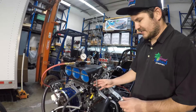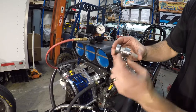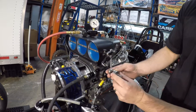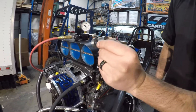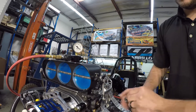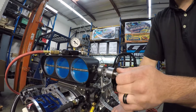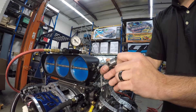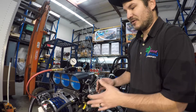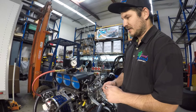To give you an idea of what you're doing when you set the leak down and how that affects things: the metering piston is sitting here and you can see there's a little notch in there for fuel to get by. There's also a notch on the Enderle spool here, which is usually up in about the 12 o'clock position. When we're turning the linkage, we're adjusting how much fuel is getting by at idle. Once you get to about 30% throttle, you're basically giving it full fuel flow at that point. We want to make sure for idle that we get this set correctly — if it's too low, only 30% on alcohol, it might not fire up or it might be getting really hot. We want to make sure it's cooling it down and getting enough fuel at idle. It's very crucial to set the leak down properly, and it's pretty simple to do, but you can mess up your system if done incorrectly.